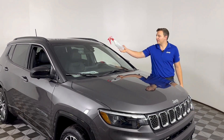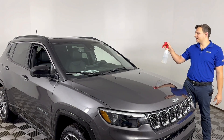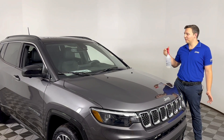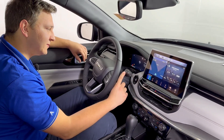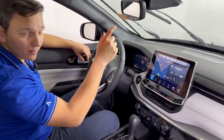The sensors are actually going to be up in this mirror area right here. When they are toggled on, you get water up there from the rain and it will automatically engage them and wipe it off. So if you have the rain sensing wipers turned on, either of these first two settings here, they're going to work anytime there's water up on that mirror.